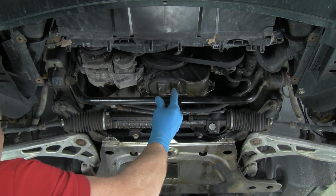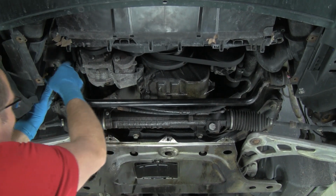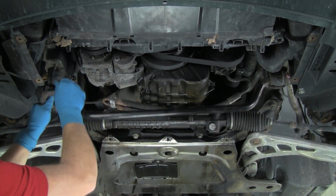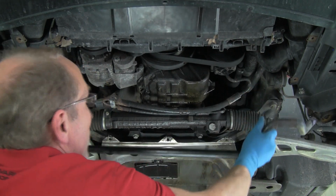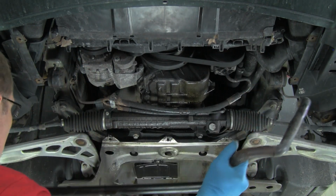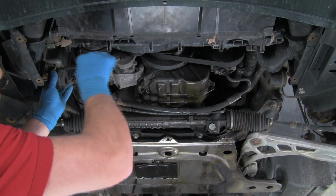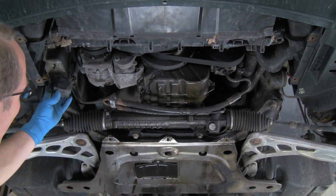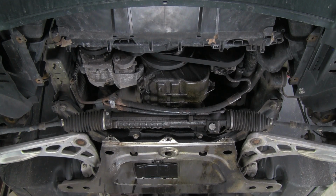And at this point, the bar will come right down. The rubber on this is stuck to the chassis actually. We'll pull the bar out of the rubber through the splits. There we go. Set it aside. And we'll get these rubber bushings down, and see those were just stuck to the metal. Actually made it easier to remove the bar.